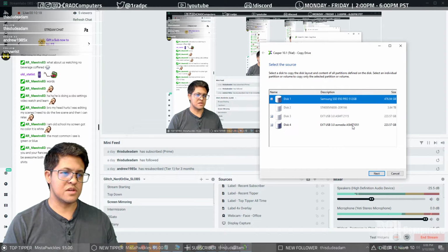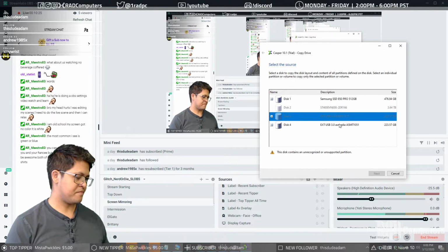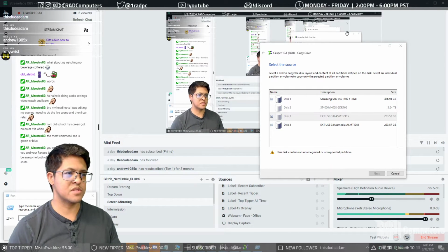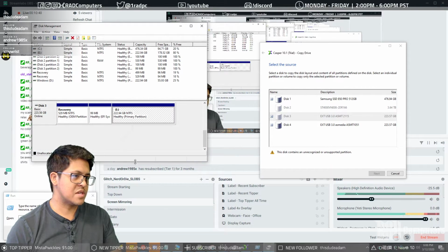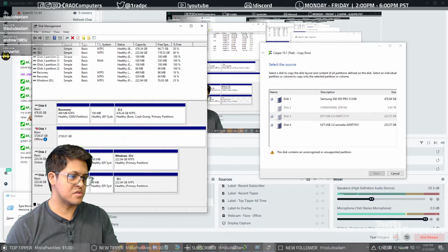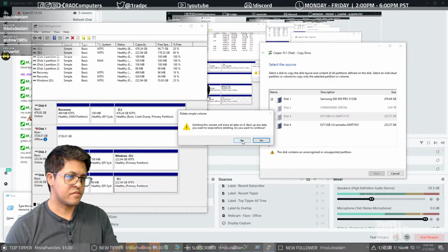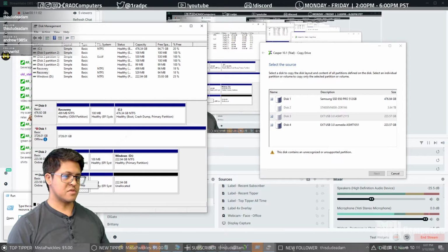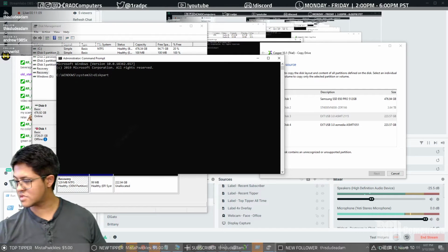Here's what we're going to do though. So we're going to take this and, well, that's not good. That's the drive. I'm pretty sure that's going to be the drive that we need to clone. So let's bring up the disk management center real quick. Okay, so that's the E drive right there. That's the one that we can scrap. One that just says owner. Yeah, okay. That's disk 3. Of course, disk management console isn't going to let us strip these out, so what we're going to do is, just a second.